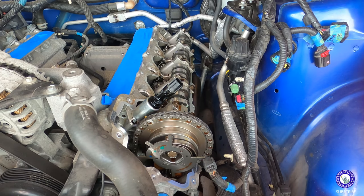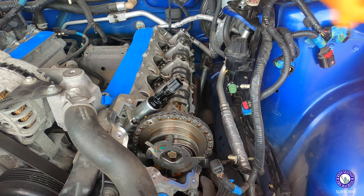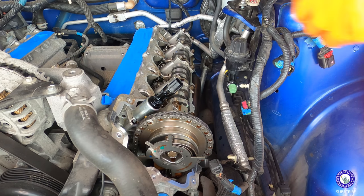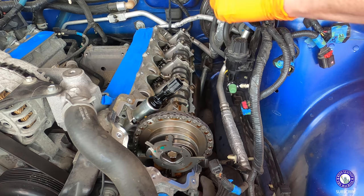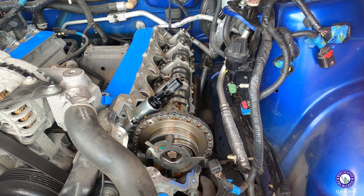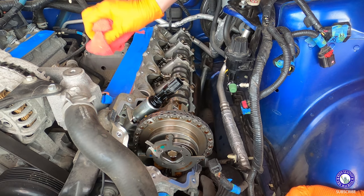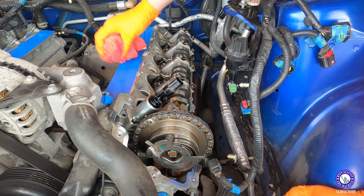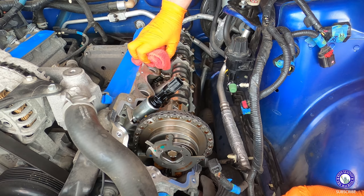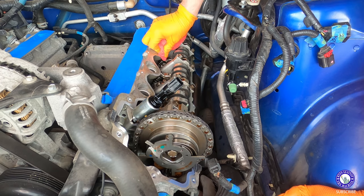I have to take the two spots where there's sealant, right here and right there. Just scrape all that out of there. Put some new sealant on before we put the new valve covers on. And also I'm gonna clean up, we've seen something fall in there. I'm gonna clean all that up, get all that out the way. Try to keep this debris from falling in there. There's a little bit in there. We'll try to do it nice and slow and steady. Looks like it's gonna be tough not to get anything in there. We'll try our best. Nice and cleaned up.